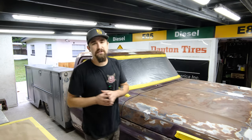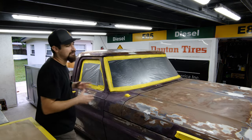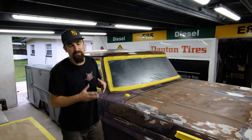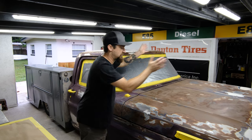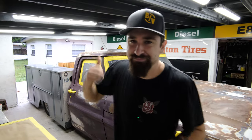Right now it is actually the next morning — Wednesday morning — and the hurricane is here right now, but I'm not going to let some rain and wind stop me. In central Florida it's really not as bad as it was up in the panhandle. What I want to do right now is get some primer on this car so I can start to see what's going on with it — any low spots, anything I want to block out. I'm picking and choosing to what extent I want to do body work. There are a few dings I'm actually going to highlight with an airbrush. But before I can do that, I want to lay down my primer as the first step of any paint process. I still want to do an official, good, nice paint job, even though in the end it won't be a traditional one. Let's get that primer mix laid down — and the hurricane can suck it.